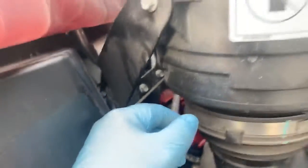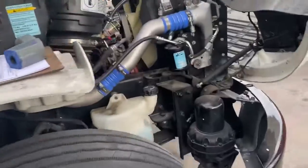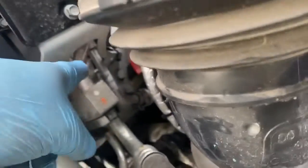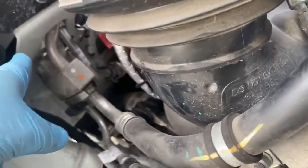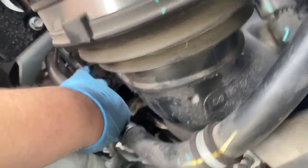It bolts inside the cab and then goes up inside the cab, up in here, comes up through here, and behind here is your fan and your evaporator. And then after it goes into there — through the expansion valve which I showed you up in there — it comes back down to this line after it goes through here. So you're still on the high side when it comes back out, goes to the expansion valve. Evaporator comes back out here, which is going to be cold — really cold — so the touch can be very cold. And it comes back and returns to the compressor.